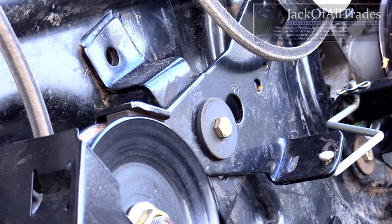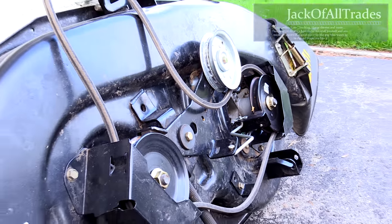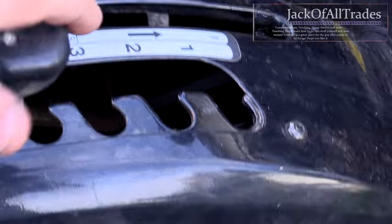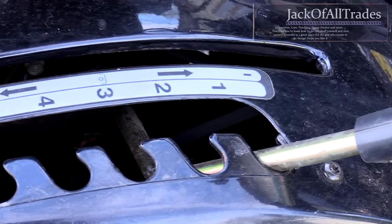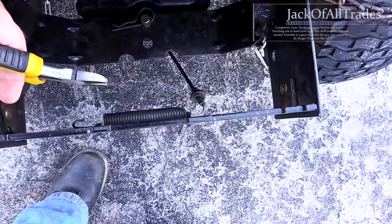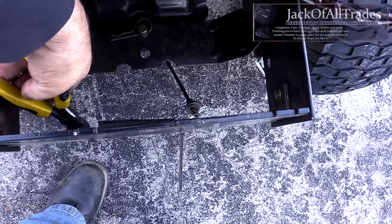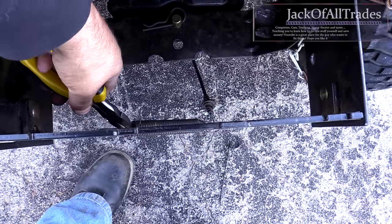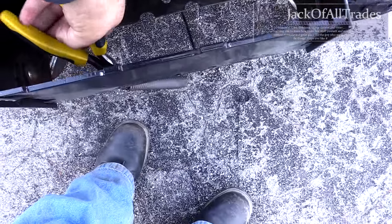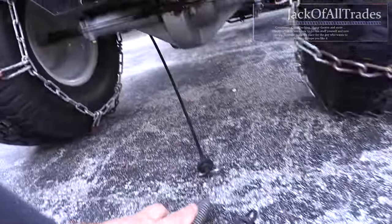Here's a close-up on what it looks like. There are a couple of tricky little pins we have to go through, so I'll take you step by step. First thing you want to do is lower the mower deck. Now, this step you won't have to do, but this tractor was set up for a snow plow and tire chains, so I put the mower deck engage wire on the back here — just snip it off, that's what it looks like.